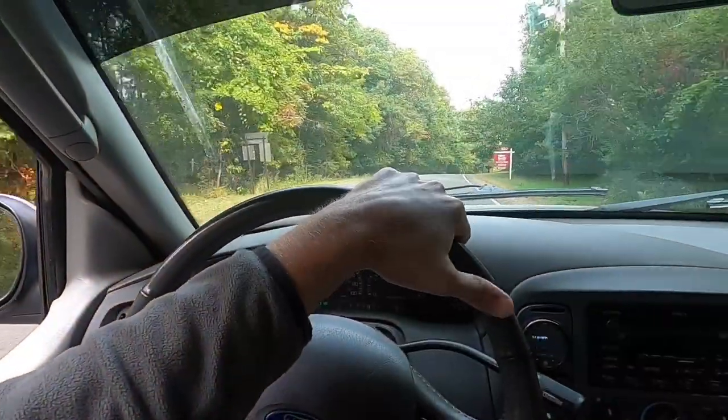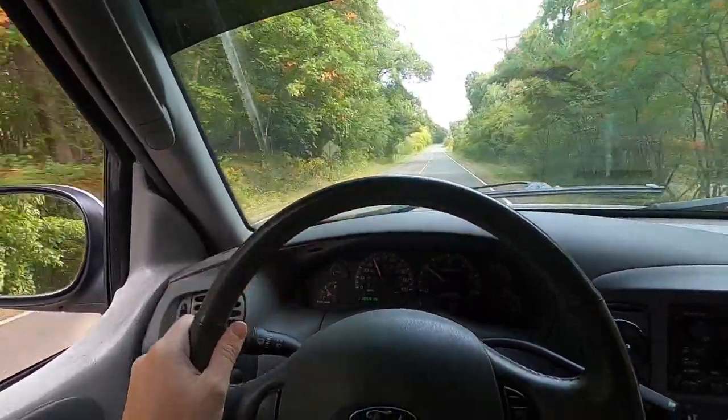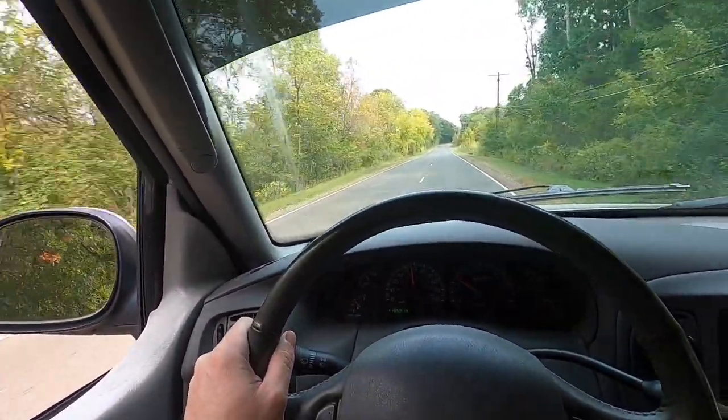So now it's got that flutter noise - sounds really, really awesome. One more time. I hope you guys can hear that. I really have no clue why it's doing that. The only thing that I've changed is I've upped the pressure on the wastegate, but I'm not even getting into really any boost and it's making that noise. I'm not going to complain because it sounds really awesome, but if you guys know why it might be doing that, leave a comment down below and let me know what you think.